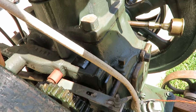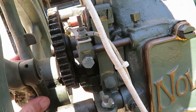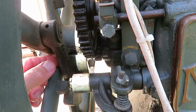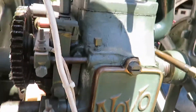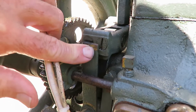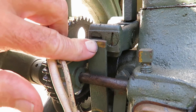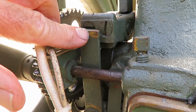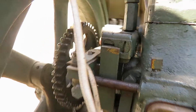When it's ready to fire, it touches this and completes the ground. And this here is the governor. As it goes around, centrifugal force pulls it out. As it pulls out, it pushes this thing in here, and that locks the exhaust valve open, and it freewheels. It saves gasoline that way because with that exhaust valve locked open, there's no suction and it doesn't suck any gas in. And then when it slows down, this thing pops out, the exhaust valve works, and it fires.